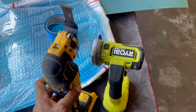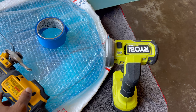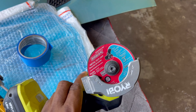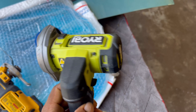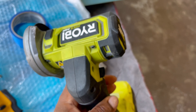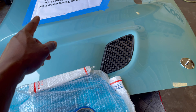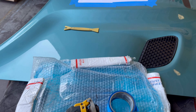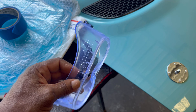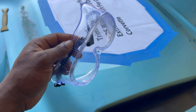These are the two blades I'm cutting with: an oscillating multi-tool with a metal blade and a three-inch grinder — pretty much a metal cut-off. I'm going to use the grinder to cut the long lines and the multi-tool to go around the curves. Make sure y'all got your goggles — that metal can fly back and hit you in the eye, so make sure you're protecting yourself.